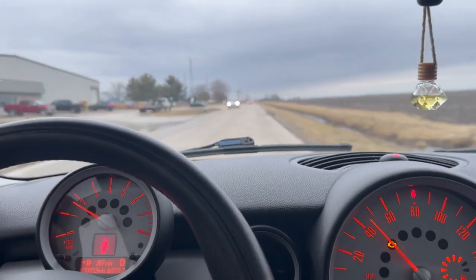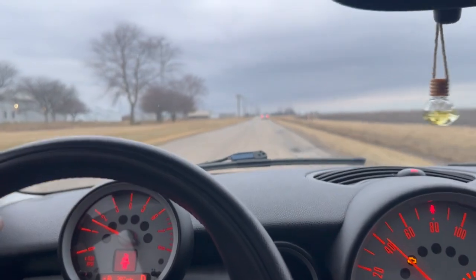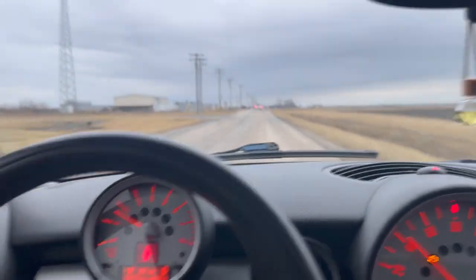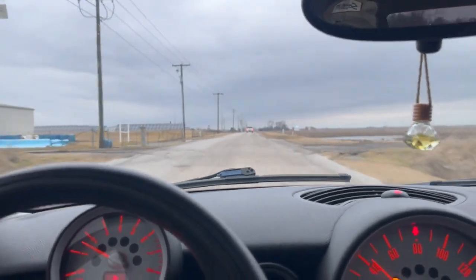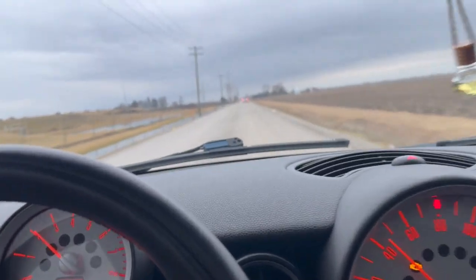Yeah, so basically sit there and let it idle for about 20 minutes. The antifreeze level did go down once, so I added antifreeze to it. It was up to par on that. The oil level's up to par. Engine runs good. There's no leaks on the engine, which is a major plus. That's what we were trying to solve. We can hear no exhaust leaks, nothing like that.